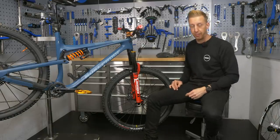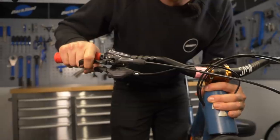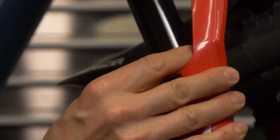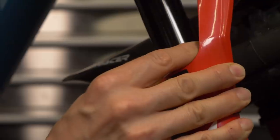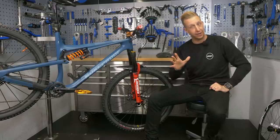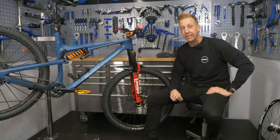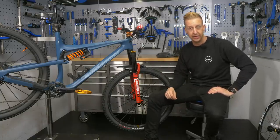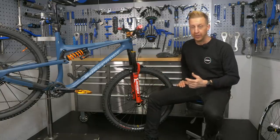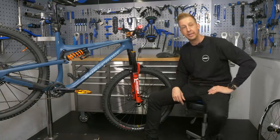A good way of feeling if it is this part of the bike is putting the front brake on, having your bike on the ground, and you can feel if the headset's loose by moving it backwards and forwards. You'll actually feel some movement on the top or the bottom, but you can also do the same at the fork — just put your hand around it. Do it like this rather than leaning on the bike, because the second you lean on it you can compress the fork, which adds another confusing variable. A very small amount of play isn't really a problem; there has to be some movement for them to move up and down, otherwise there'll be too much binding. If there's a lot of movement, you may need a proper fork service.